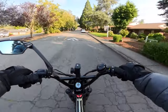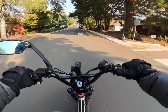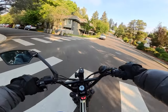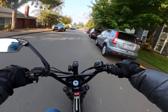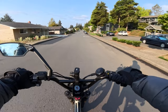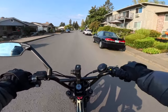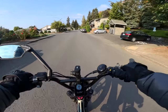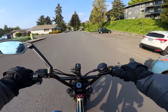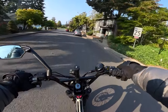So riding throttle only — which I think most of us on the original Lyra Graffiti do anyway — and riding around 25 miles per hour, say between 20 and 30 but mostly around 25, it looks like you can get approximately 25 miles on one battery. So conservatively, say 20 miles. That means with these two batteries at 35 amp hour total, you can pretty much count on getting 40 miles riding in the 25 mph range.